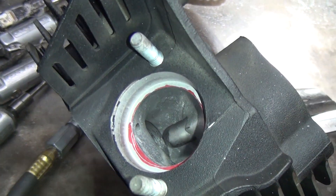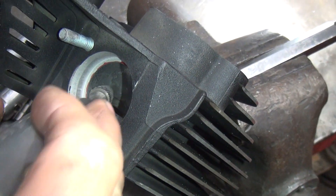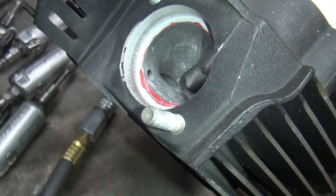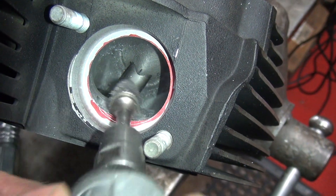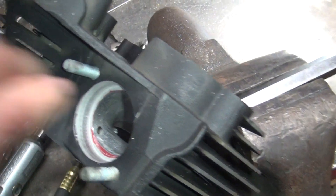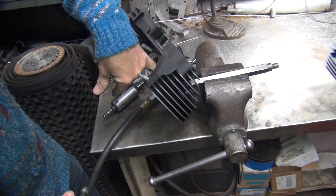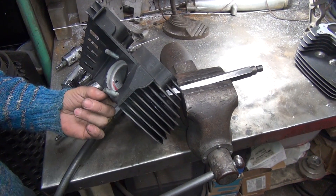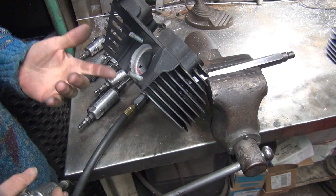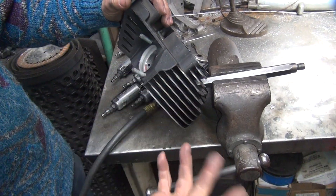So I took my flat cutter — this one — you see I fall across here and go like this with the port. See the angle coming out? You just kind of roll it down a little bit, go straight across. What's left is that D. I have to look at my angle — the cutter comes out like this. Kind of cut like this right across that. If that was in the way it would have been cut away. It's not in the way — leave it. Now when the exhaust comes back this way it hits a dam, so it doesn't want to get feedback in the cylinder, so that actually makes flow a bit better. This would be better if it was plugged up more over here — making the port smaller through there would help. On a street bike you want to try to keep it as small as you can but flow good. On a race bike you cut more away because it'll kill lower flow but help on the high lift flow. So it's a street bike, so we still got to keep it within reason.